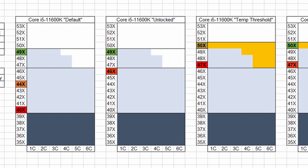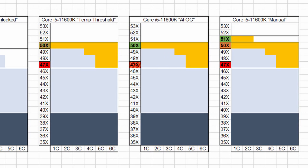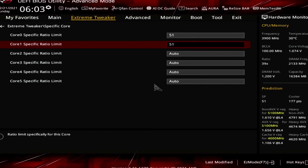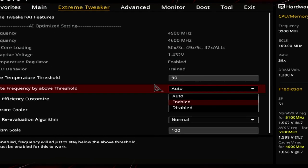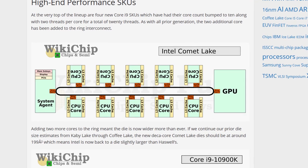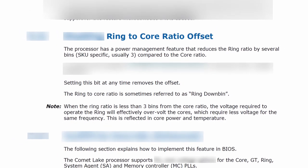In our last overclocking strategy, we try to build on what we've learned so far and maximize system performance. While that may sound as simple as increasing the CPU ratio from 50x to 51x, it turns out to be a bit more complicated. In the end, we're only able to increase the frequency to 5.1 GHz for our two best cores and leave the other cores at 5 GHz. We use Rocket Lake's new per-core ratio limit feature to ensure 5.1 GHz is only applied to the best two cores. We also enable XMP, use the CPU package temperature threshold targeting 90°C, and enable Ring Down Bin to allow the CPU to automatically reduce ring frequency if necessary for stability.